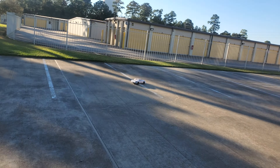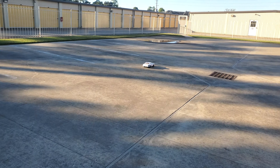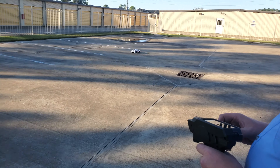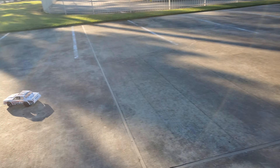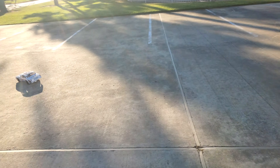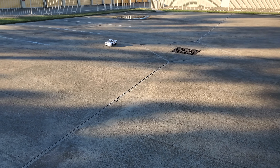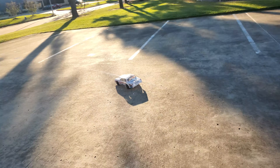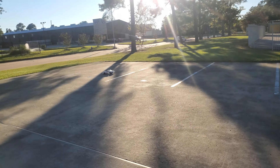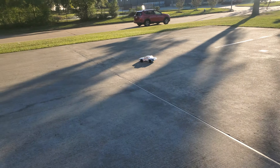Handles great around this corner — there it goes, full speed, avoid that puddle, round the drain, back to the figure of eights again. Turn the power on a little bit — it's really leaning, it doesn't want to turn over on us, it's not trying to flip, it doesn't traction roll. They did a good job picking a good tyre combination to work with this power system. It is a real fun car to drive. You can see it lifted the front wheel there. I think the gyro does help with some of these tight manoeuvres, but it also induces — especially on the straight, if you're just trying to correct a little bit — it'll do like a little wobble. Maybe the gain's a little bit too high on it. It doesn't really try and take over the driving from you — it's not going to fix you being a bad driver. You need practice to become a good driver, even in a real car or an RC car.